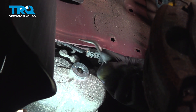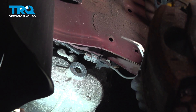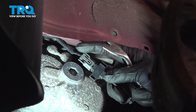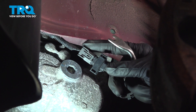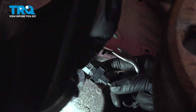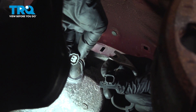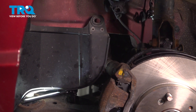Give it a quick inspection and pull this aside. Now we'll just make our way in here and pry this out of place. At this point, we'll take hold of that gray connector. On this, you'll find that there's a small squeeze tab — squeeze that to unlock it and then separate the two pieces. Give each side a quick inspection for corrosion, and we can set that wiring aside and remove that ABS sensor.